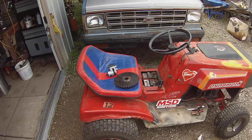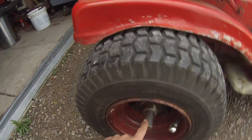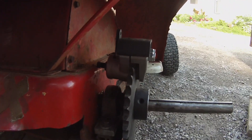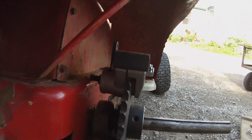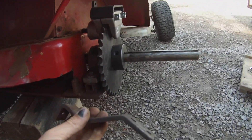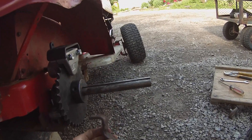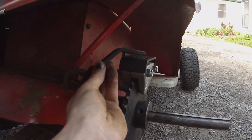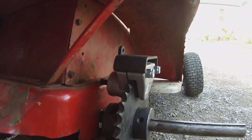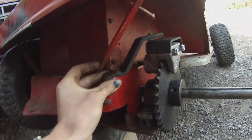Let's see if we can get this to fit over this, and then maybe grind the teeth. This is one inch so it'll fit over here. I'll start by taking this wheel off because I want it on this side. I flipped the lever around because it was going the wrong way — I just punched out the pin and turned it around. I have to run some washers in between for the thickness. This is the old front transmission transaxle mount. If I put this here, cut that 90 degrees off at the end, that can go right there as a brake mount.